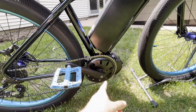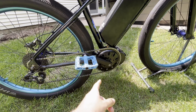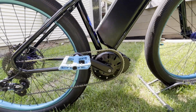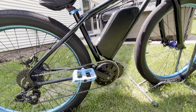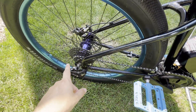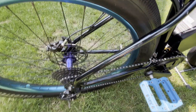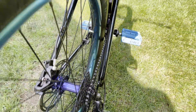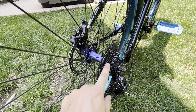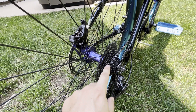On this side of the bike, we have the chain ring. This is the stock chain ring — I believe it's 46 tooth, pretty big compared to the original one that came on this bike. It kind of doesn't line up with the rear gears, so the chain line is a little bit out of whack. I'm not able to use the first, second, third, and fourth gears — I'm only able to use gears five through ten.